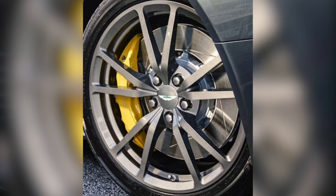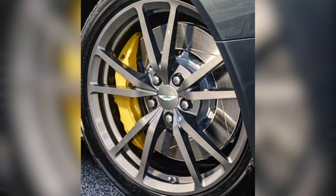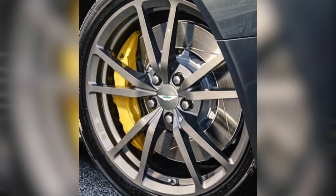Here's a picture of what's called a co-cast disc. It's still a 380mm diameter and still a six piston caliper, exactly the same caliper as on the Vantage S. But the disc has changed from being two piece to co-cast. Technically it's still a two piece disc in that there are two different metals, and apparently the outer rotor can expand through heat on the mounting hooks. But heat management is not the same — on this co-cast disc it is possible to encounter heat fade.